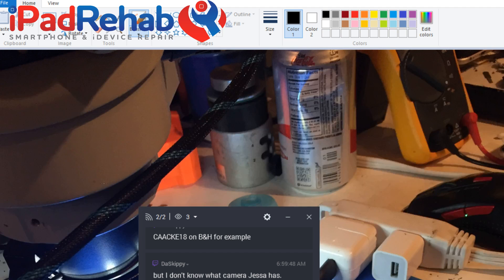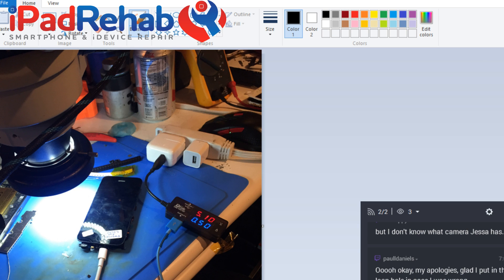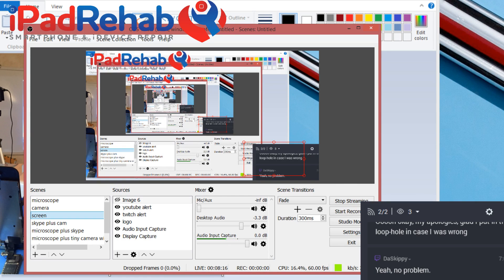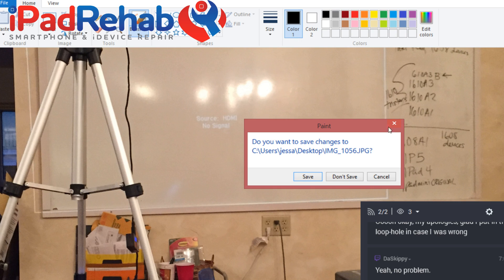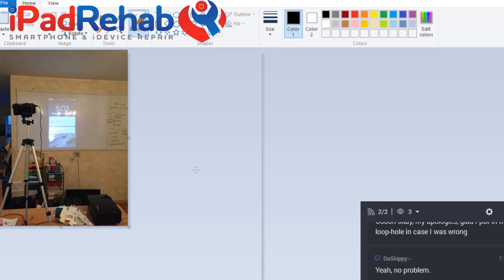Here we are — this is the 3v0-deleted phone trying to do the same thing. Just a second ago we saw it could charge normally at 1 amp through the iPad charger directly, but when connected through the accessory dongle it does not charge normally — it's charging at 0.5 amps. And here this is showing 'HDMI no signal' — with the 3v0-deleted phone I could not use the accessory to output HDMI.